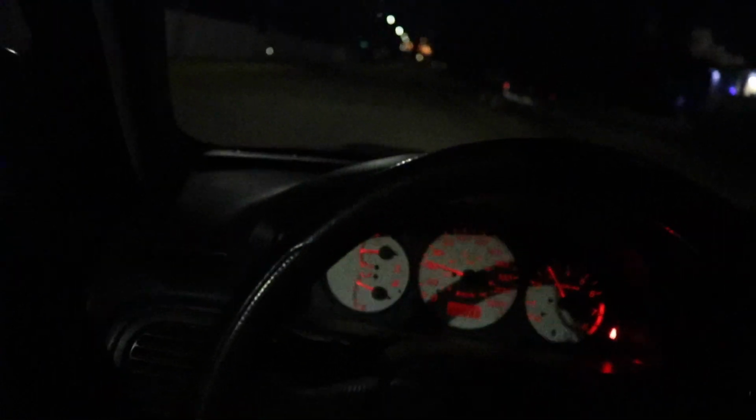Boys, it's like 2 a.m. but we got this thing on the road. Steering wheel is relatively straight still. I adjusted the height on the front coils and the preload on the springs. Messed with my camber a little bit. Now it's still pulling to the right, but not as hard. I can tell the toe is out a little bit for sure.